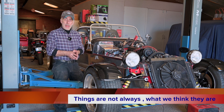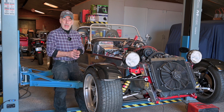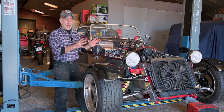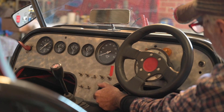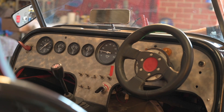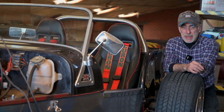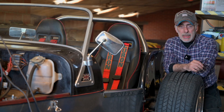The first thing we're going to do is measure the compression, and then we'll do a cylinder leakage test. For both tests you'll need some tools — they're not expensive and worthwhile the investment. First, we're going to start the engine and let it warm up. As you can tell, it is not running very smooth — it's really shaking a lot. That's because of the last three cylinders; you can even hear it in the sound. I suspect a compression problem, so we're going to start testing that very soon.